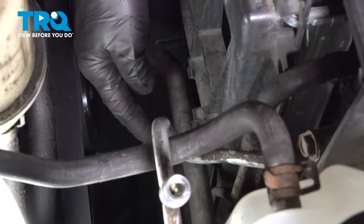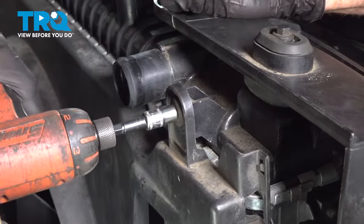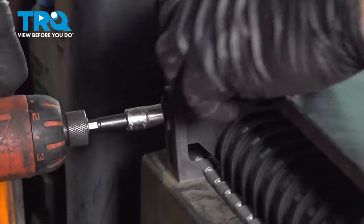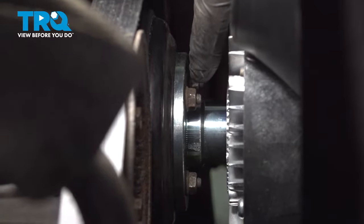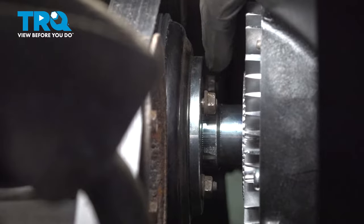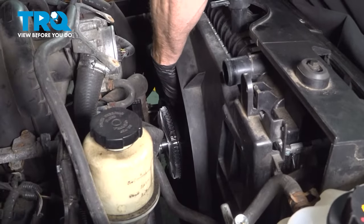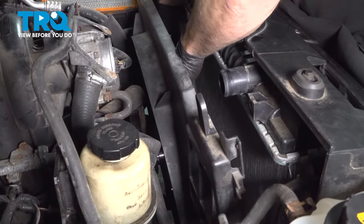Down underneath that, you'll find that you have another hose that should be pressed into the fan shroud. Just go ahead and dislodge that. Continue on to your fan shroud bolts — we're going to loosen these, leaving them in there just a couple threads. Now we can start removing our fan from the area. You'll find that it's held in place with four 10 millimeter headed nuts. Go ahead and carefully remove all of those, leaving one on just a couple threads. Continue on to fully removing your last nut on the fan while holding the fan in place. Once you have that nut off, the fan should be able to break free. We'll carefully pull this up and out of the area and set it aside.